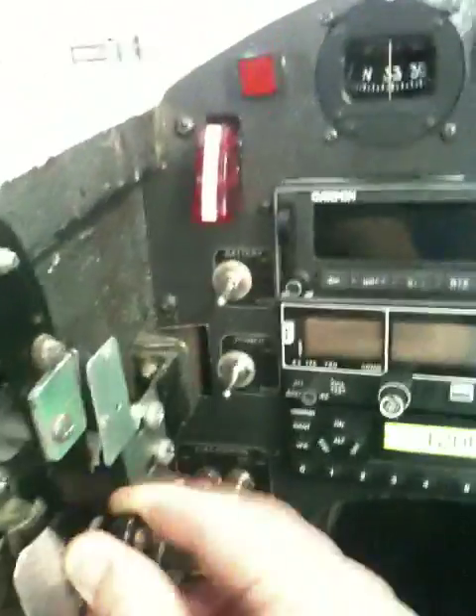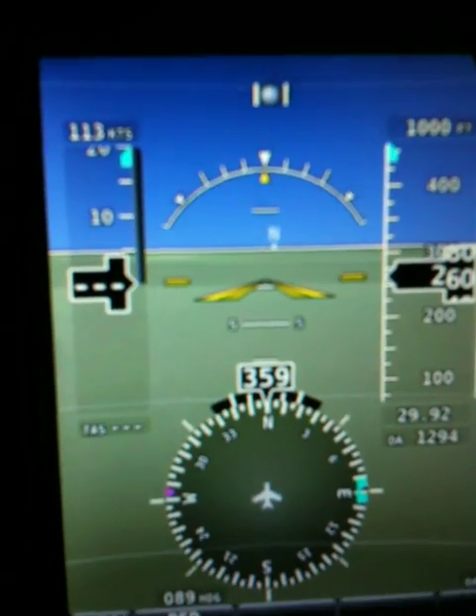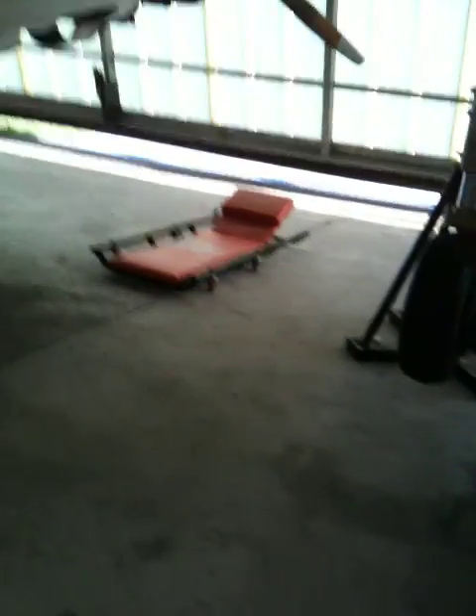So now we're going to close the canopy, advance the throttle past about three-quarters of the way, and put the landing gear switch up — nothing happens, because it thinks we're trying to fly but airspeed is indicated at zero on the PFD. It's still saying there's a problem. So I built in a switch to override — it's called the AS override, airspeed override. By pushing this switch, it tells the airplane we're actually going 80 knots. At that point, all three gears retract. There we go — there they go.